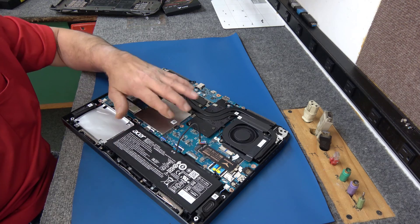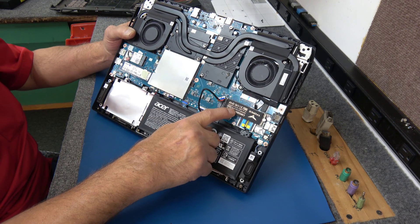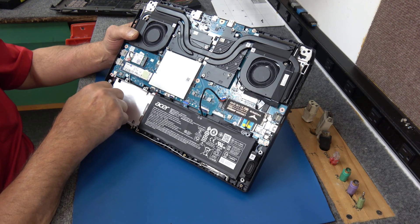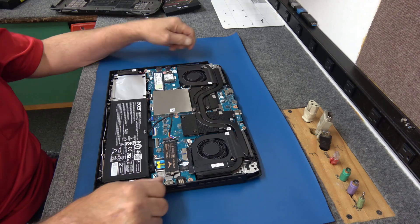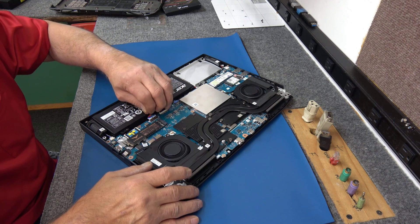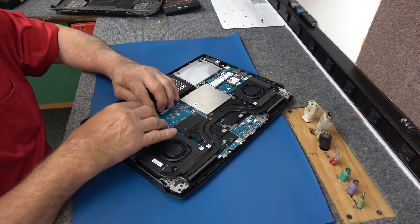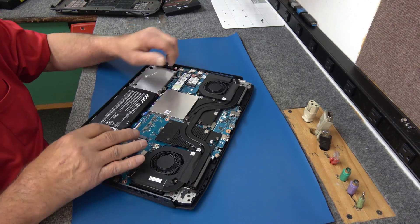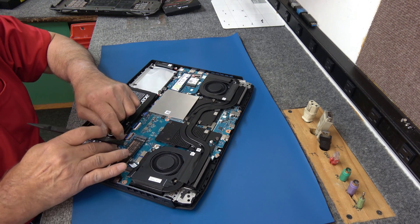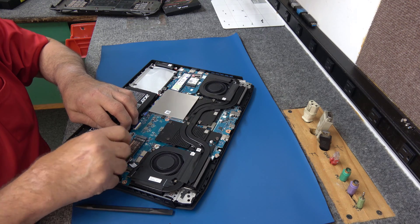When you're inside your laptop doing anything, just don't touch anything you absolutely don't have to — that's a good rule of thumb. So we've got our extra 2 terabyte Gen 4 M.2 drive. We've got the factory 1 terabyte PCI Express 4.0 — it says right on it, which is nice to see. Last thing is we're going to plug the battery back in. Be super careful — these are pretty simple to get back in. Just make sure it's seated good, put the cable back down there, and that tape.